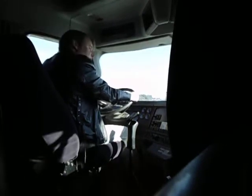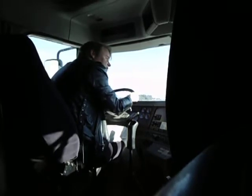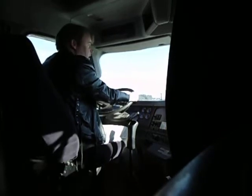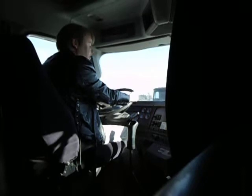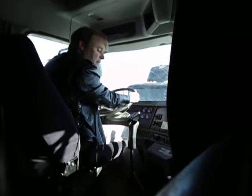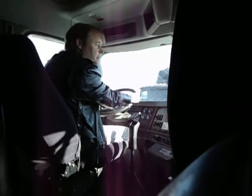Now I'm going to do my air compressor cutout test. So I'm at my engine and see when it cuts out. I'll rev it to 1200 RPMs, and it should cut out before exceeding 130 PSI.